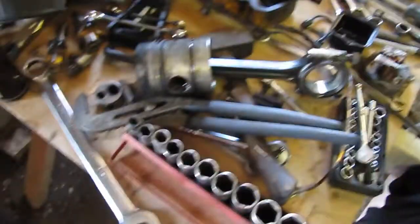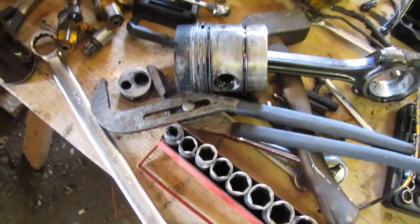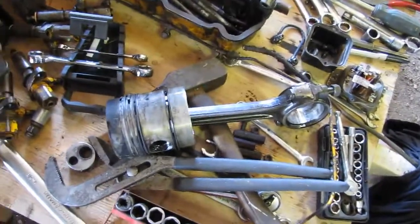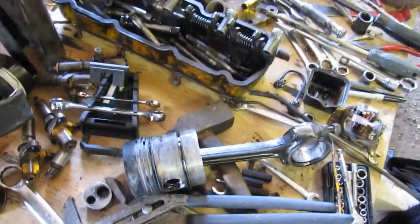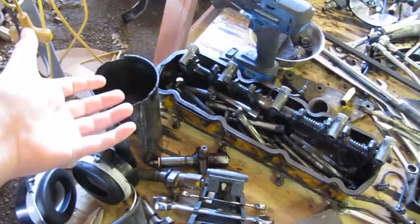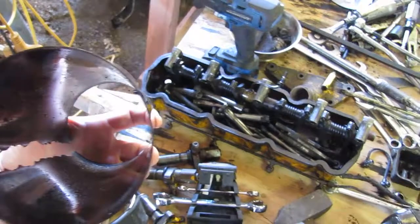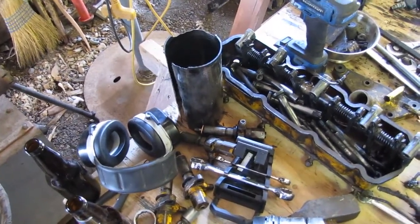As you can see, we got piston number three out and it looks pretty good — it didn't look damaged in any way, which was good. We did get that cracked sleeve out. Didn't get it out in the conventional method like most mechanics would tell you. I watched a video on this procedure. I did pull these out when I was younger with the correct puller, which is a metal plug turned to the right size to go inside and grab on the bottom of the sleeve, which you can see is pretty freaking thin — probably 30 thousandths or less.